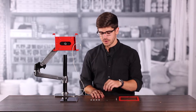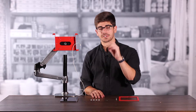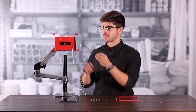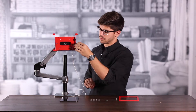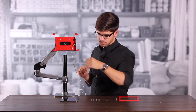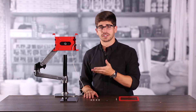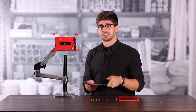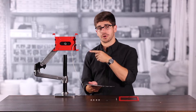Since we're using an iPad mini 4, we're going to need to use the included fit adapters. We're going to place the fit adapters in the small notches in the back plate of the frame. Now we can install our tablet and reinstall our bezel. We're going to want to be sure to put the power port of the tablet on the same side that we put the power cord.